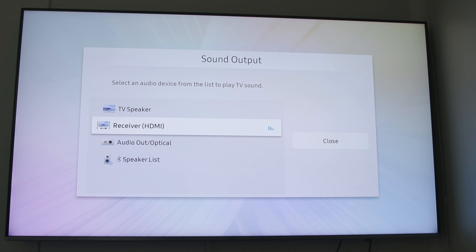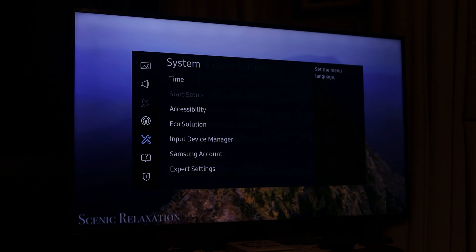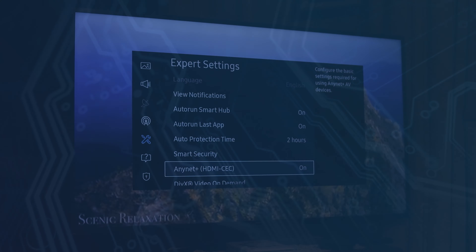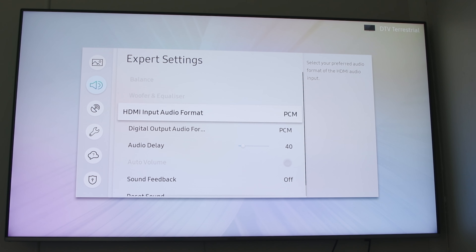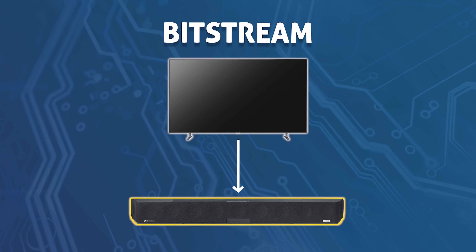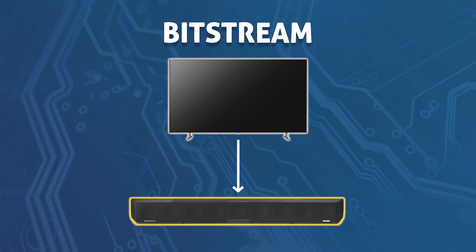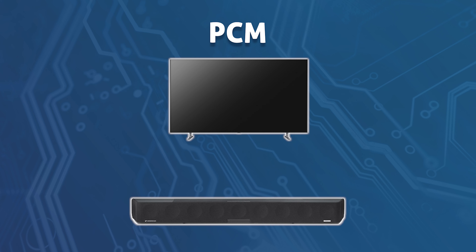Choose sound settings and manually select your soundbar's output, which will be labelled under these names. If it's still not working then make sure HDMI CEC is turned on, which will also be under these names depending on the brand of TV. Once that's done, another setting to check is that the HDMI audio output is set to Bitstream or Auto, not PCM. Bitstream instructs the TV to send through all the sound information without processing it, which is much better as the soundbar can do all the processing — that gives you better audio formats and higher quality sound. Whereas with PCM, the TV processes the audio before sending it through, which won't give you Dolby Atmos or other high-end audio formats. If you don't get the option of choosing Bitstream then select Auto.